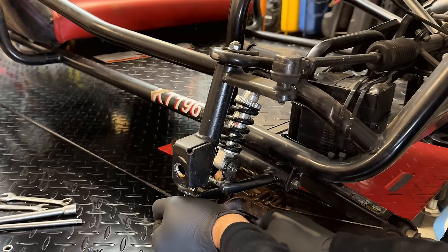And for the ignition switch, that will be off. So we need a source of ground right in the middle, which is this black wire right here. It just runs to the body ground. So we'll put that right there. And then when it's in the off position, it's this tab that's now connected. So that is going to be the return wire,